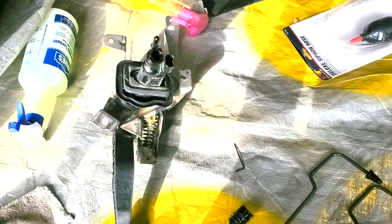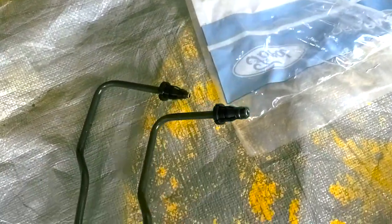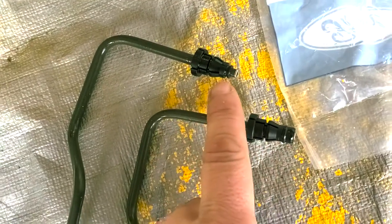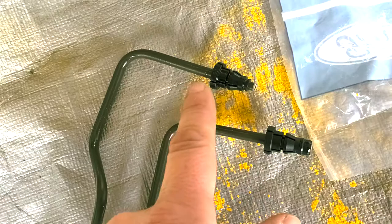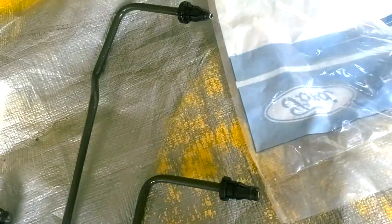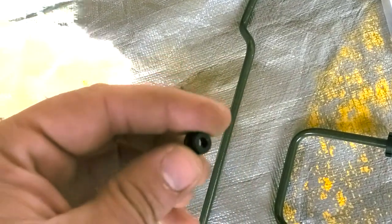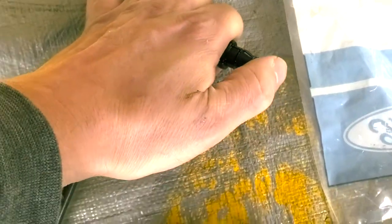I found something new that was kind of different. Here is the brand new part I just got from Ford, and when I took the first cap off, notice how the two tips are different. I found out that this is probably why I was having my leak problem — the original line is actually probably fine. What happened was this little tip was actually stuck inside the pedal. I was able to get in there with a really tiny allen key wrench, dig it out, and here it is. So we're just going to put that back on, and if we ever need the new part, it's spring-loaded and sandwiches up on there. That was the missing piece.